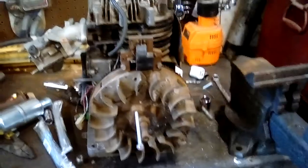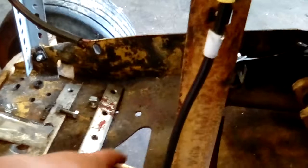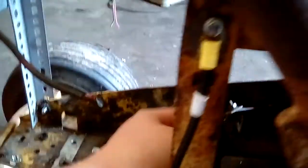Here is this small five horsepower right here. The kid I got it from — my buddy — he said the bolts kept breaking, and I know why. I told my dad, well, these bolts are really long. They're probably breaking because they're too long and flexing. But the motor sits right here, and it has to get to these holes, so they need to be pretty long. But I think we can shorten them up a little bit.